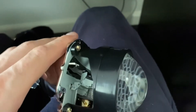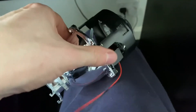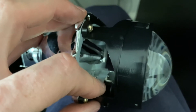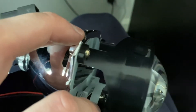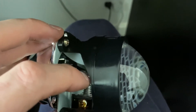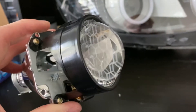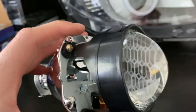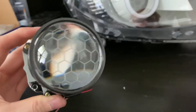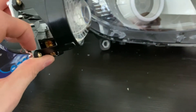For low beam, there's a little solenoid flap — this stays up and acts as our cutoff point, blocking any light that would reflect from the bottom of the reflector bowl. For high beam, when it receives a positive 12-volt signal, the solenoid clicks and flips the cutoff point down so there's no cutoff. Then when you go back to low beam it flicks back up. You can retrofit these into headlights like the Rodeo we swapped over earlier, using the low-high beam solenoid to switch with the same bulb.